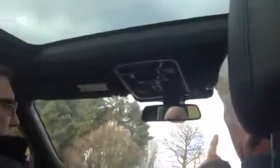Now if I ever fail to get to the top of a hill and have to reverse back down, then I must select reverse gear. But immediately I select reverse gear, with the hill descent on, the hill descent will go to its lowest target speed. Right. Don't have to mess around with it. It will do it. Okay. I'll just let Philip wander off out of the way.